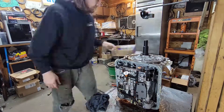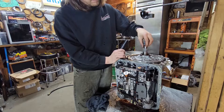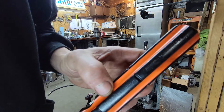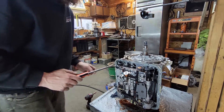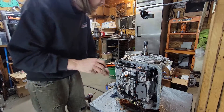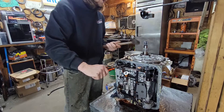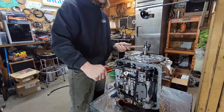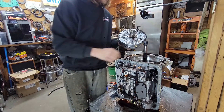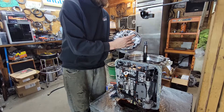Let's get that pump out of there. Make sure we take off our lockup o-ring — the pump will not slide past that. Now we'll get out the old two-fister — gotta love them old garage sale scores. What we want to do is get up underneath the pump here. There's a flat right underneath where that solenoid went in. Just gently pry up on it, you can see it come up a little bit. Then take your rubber mallet — technical term — put a little bit of pressure on your pry bar or screwdriver, hit the opposite direction, and there's the pump. Get our washer out of there right away and set this off to the side.